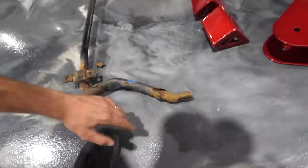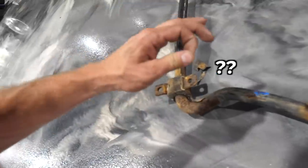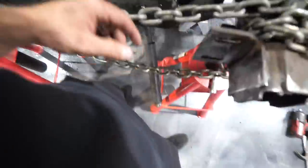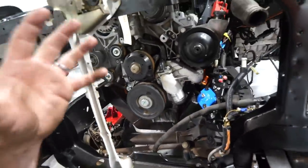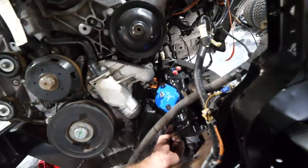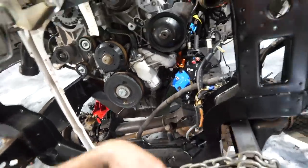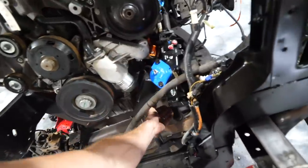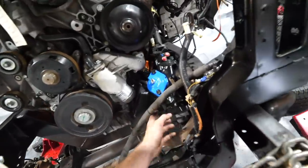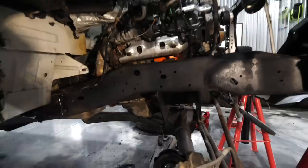We've got our factory two-wheel drive ones removed — the rivets aren't all that bad, just a cutting wheel and an air hammer. The air hammer was a lifesaver. The kit got powder coated lollipop red by Powder Work 717 — the color came out great. The kit also includes sway bar drop brackets for the 05-plus sway bar, and this beautiful one right here is in perfect condition. We've got our track bar drop bracket right here, and we also added a Blue Top steering box with the RYD pitman arm conversion. If you want to put 05 axles on, you can either get the conversion pitman arm — which gets you from the splines of the Blue Top that mounts to the factory holes on the OBS — or you can drill new holes for an 05-plus steering box. Going with the box destined for this chassis made sense because it mounts right up and all the steering lines go right in.